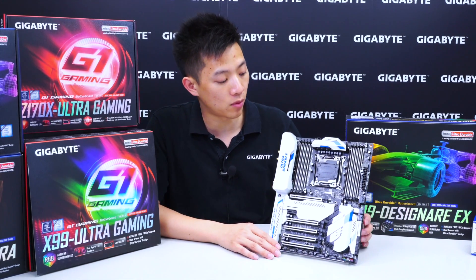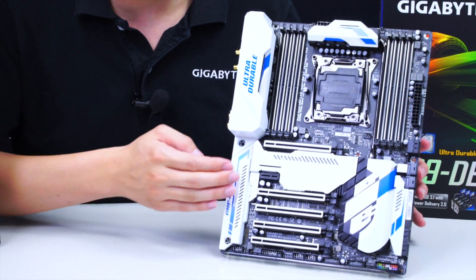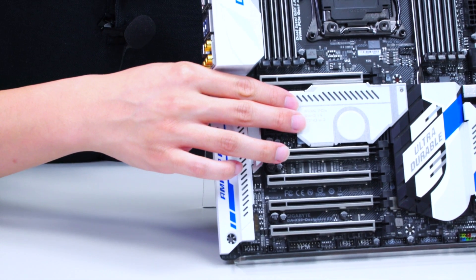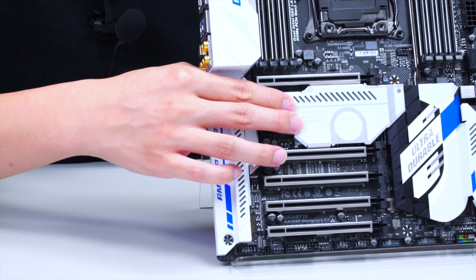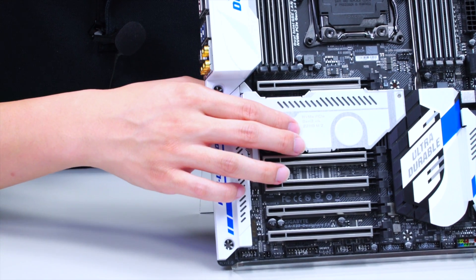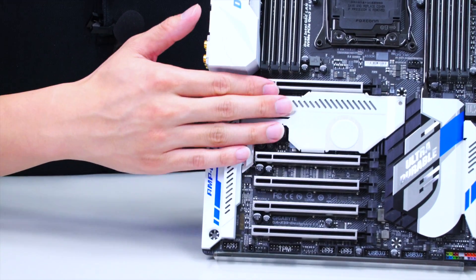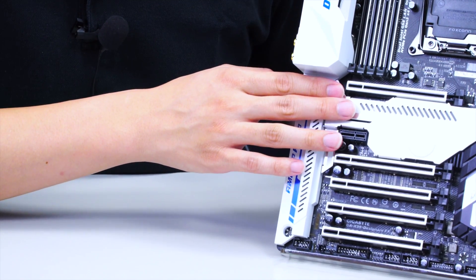Alright, so let's take a closer look at our motherboard. Right here you can see Gigabyte has gone with the classic Gigabyte blue on its shielding, and this aluminum housing actually extends from the rear I/O side of the motherboard all the way over to the PCH. This rear housing actually supports two M.2s below it — one already pre-populated with wireless AC as well as the Bluetooth 4.2 module. Another M.2 slot is open which allows you to attach any M.2 storage device up to the 22mm by 110mm length. You can also choose to use 42mm, 60mm or 80mm in here as well. All the M.2 speeds are at 32 gigabits per second.